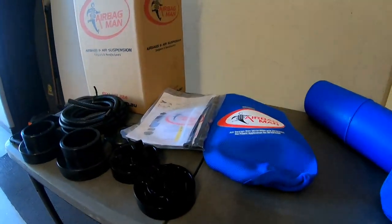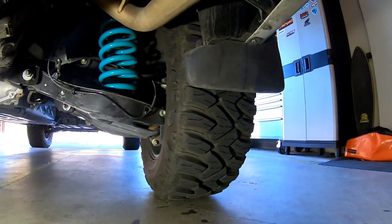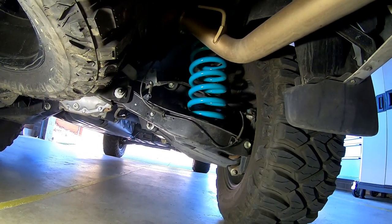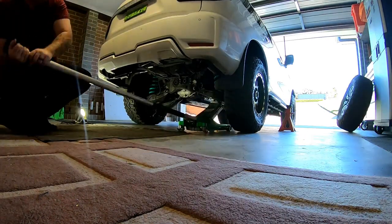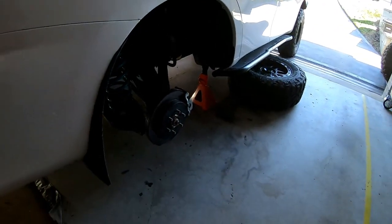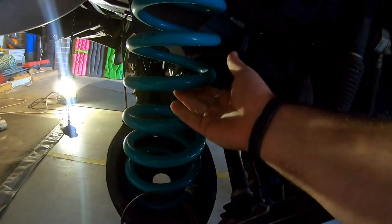Because I'm doing this on the garage floor, we're going to drop the spare tire out to create some room. We'll jack the car up, take this wheel off, put it on stands. From there we'll lower that lower arm all the way down to get the spring to fully extend, and then hopefully it should just be easy slotting the bag in. That's the prep work done. Car's on stands. Tire leaning into the car in case the stand fails - unlikely, but just something I've always done.